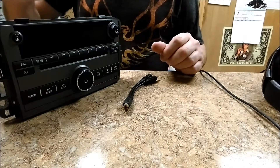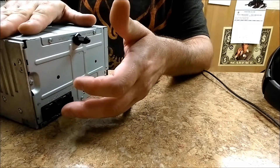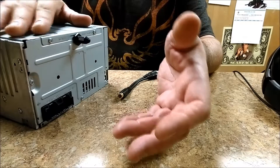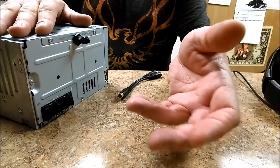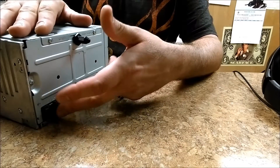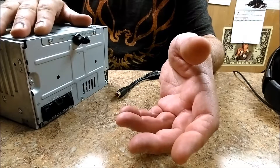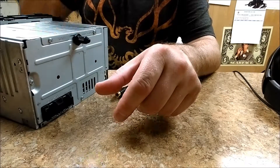In the back of the head unit there is a plug for your amplified speaker output and your power source. I don't recommend cutting up the stock harness inside the vehicle. You can buy at almost any auto parts store an adapter harness — a plug that connects to the stock harness of your vehicle, which has all your speaker wires plus your positive, negative, and constant power. The color codes of the wires on the adapter match up with whatever plug comes with your aftermarket stereo — just match them up correctly.